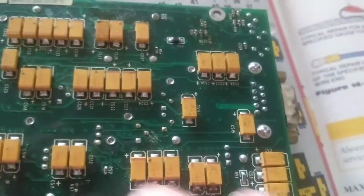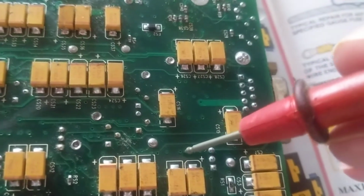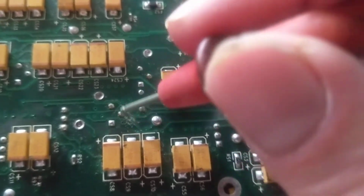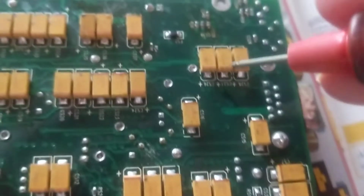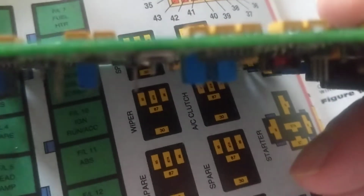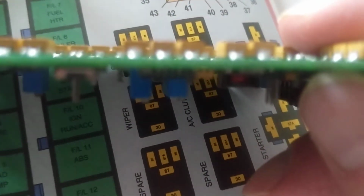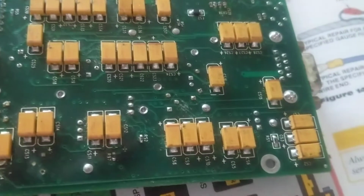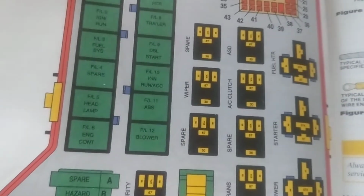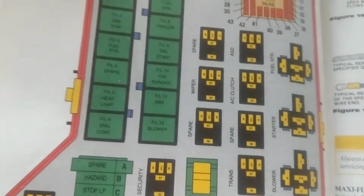If I have a relay board with just one layer on top, and there's a crack on the board and I fix it, fine, I can fix that problem because it's only one layer. These are multi-layer boards. I've seen boards that have 10 layers in between. Can you imagine? Grounds, B+, everything. They want to make the boards small, obviously, so we can make the computer smaller. And that's the idea of it. Now, the other thing that I wanted to show you, like I said, when we talk about PCM boards, this is the PCM board. I wanted to give you an illustration of what we're dealing with, and that's the board you just saw.